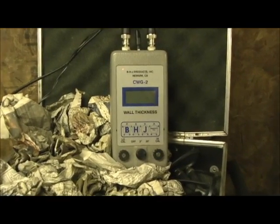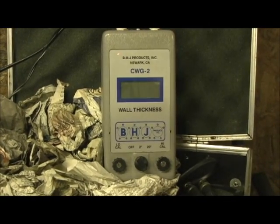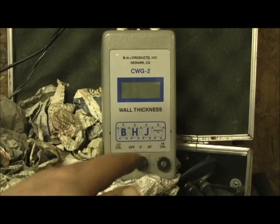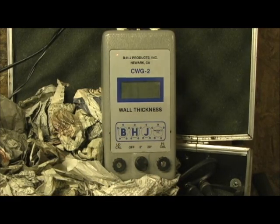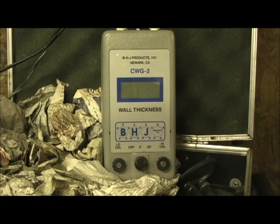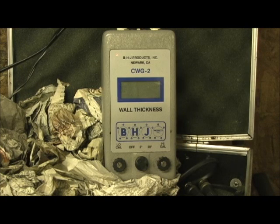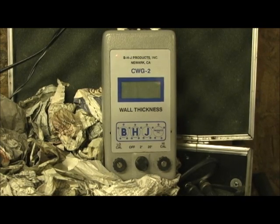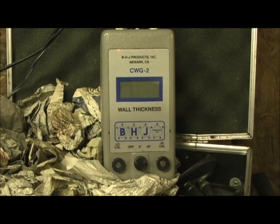As you can see, it shows BHJ Products, Newark, California — wall thickness. You have a low calibration and a high calibration. I've got a piece of metal with a curved piece of cylinder bore, like a chopped section of a bore, and there are actually four pieces of it — one from Chrysler, one from Ford, one from GM, and another one. Just to show you that each company uses different metals in their castings, and that can make a few thousandths difference. I go off of the cylinder head dependent on the block — common logic dictates that whatever foundry they use on the block, they used on the head.